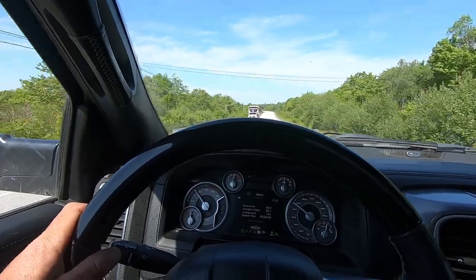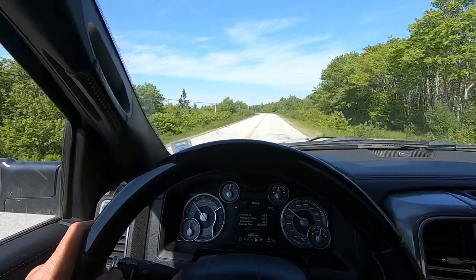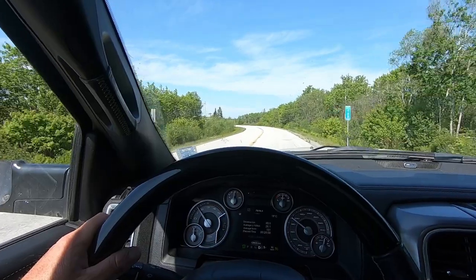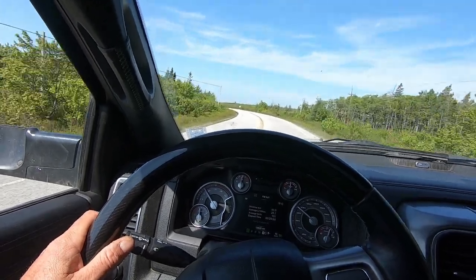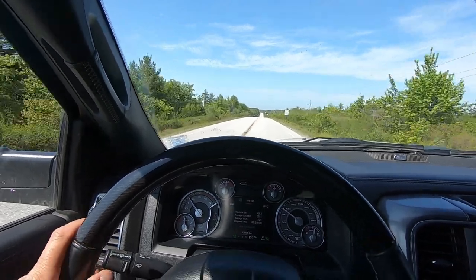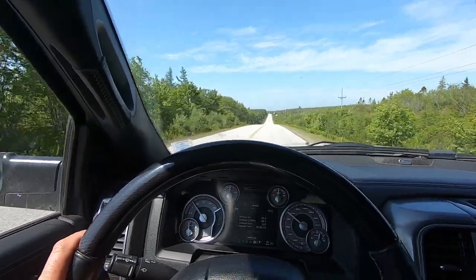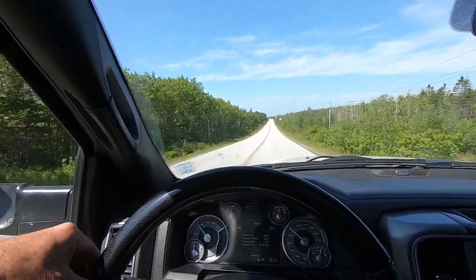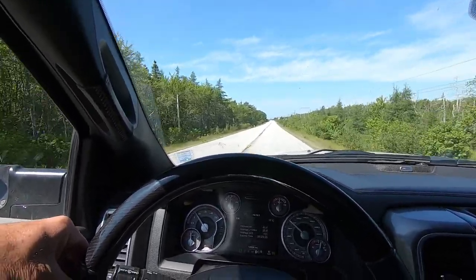It just must not have been steep enough — it was in between those gears. And obviously that is the big selling feature and the beauty of the higher-gear transmissions: there's always a gear these things like. With six gears the gears are further apart, especially with the 3.42 rear end. I don't think any of these trucks should ever come out of the dealership with a 3.42 — a Ram truck is known for hauling weights. They went to the 3.42 for fuel mileage, but guys buy these trucks to tow camper trailers, equipment, all that sort of stuff. 3.73 with a six-speed transmission is what you'd want. My 350 has a 3.55 and it does pretty good, but it'd be even better with a 3.73.